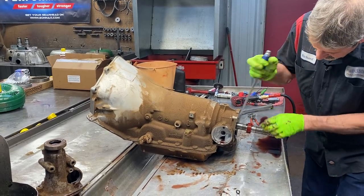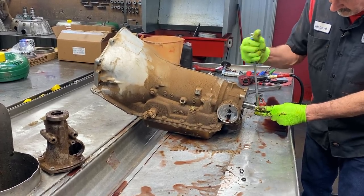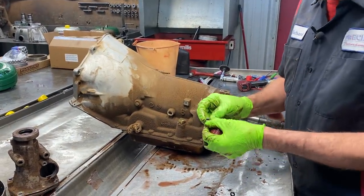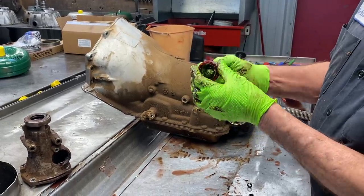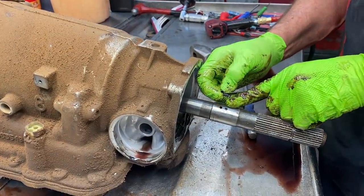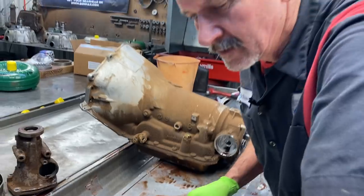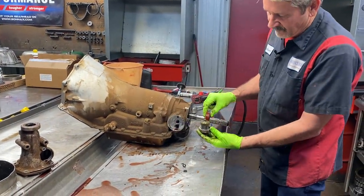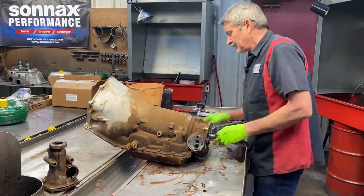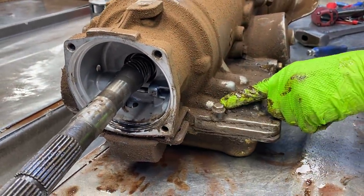You have your speedometer gear here — the inner one. Most of the time you'll break the gear trying to remove it. I've just been doing it a long time. This little tab right here holds the gear on — it's got two little fingers that hook on this side of the gear, and a tab that goes in the shaft in the hole. Now, we do have dual holes here, so you want to make sure you get it in the right one. I always put it in this one, the one towards the rear. You can put it in the other one but it'll get the gear off center. Also we've got a bolt and nut coming through the case, so we've probably got a stripped area where we're going to have to put a helicoil.